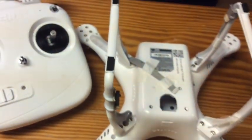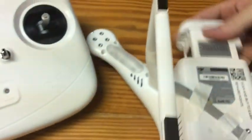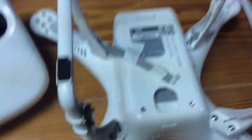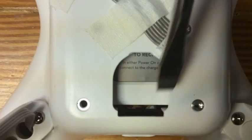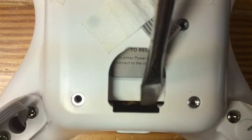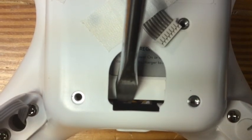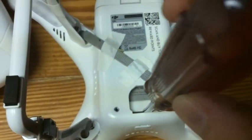Just for demonstration — the hole is in the very front here and you'll see those wires right down in here. You want to be really careful that you don't touch these wires; if you do, you're going to damage your Phantom. So using this edge right here and the edge of the battery, very carefully put the very edge of the screwdriver on the edge of the battery.